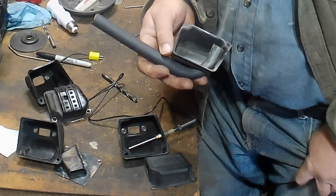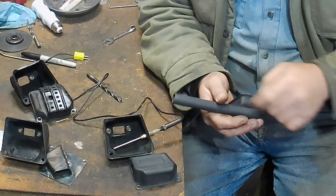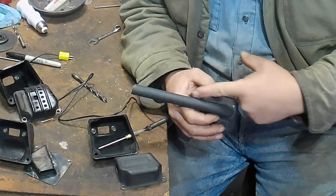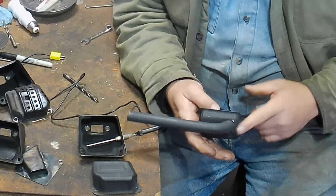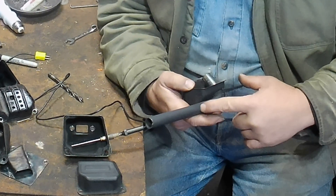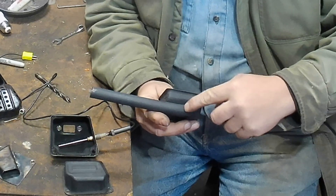Kevin just mentioned a while ago — it was kind of funny, I was already building this — and he's like, put more inside the can than sticking out. And I've always liked that too, especially on a little short one. But I run it to the starter side of the saw, right? This is starter side, so that's where it would blow out. That's where my holes have been. So we can get all this pipe here used out to probably about there without it hanging off the saw. I'd probably rather it be back in there. I will have to weld a little kickstand on it, unless we end up shortening it up more.